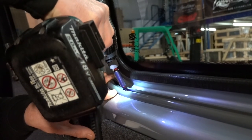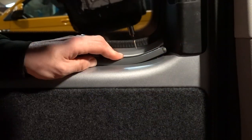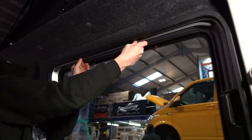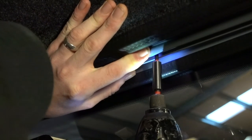If the curve is slightly off on your rail, use a mallet to flatten it out. When you screw it in you'll see it will also pull the rail down into place. Get the other rail and offer it into place at the top, fix it in place making sure it's straight along the vehicle.